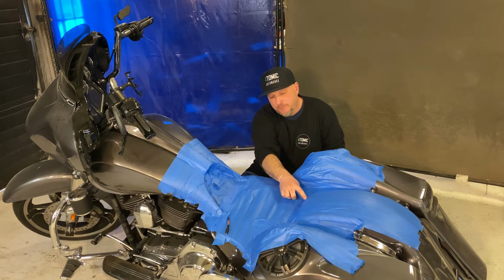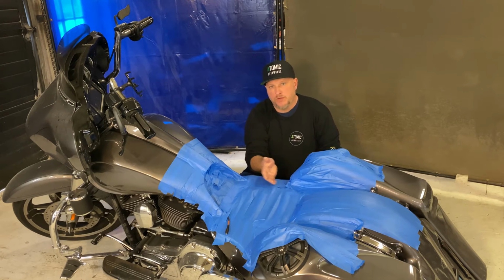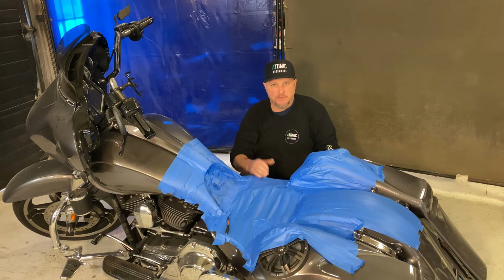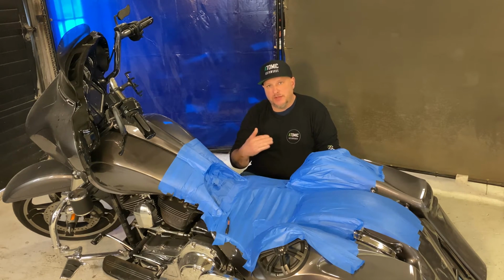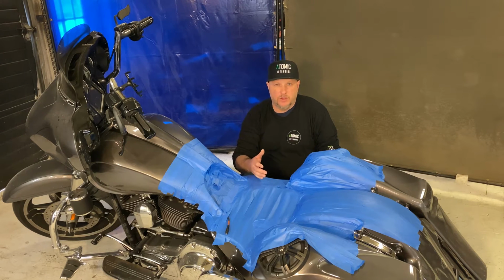And when it hits the front part of the rear fender, this area becomes too small with the material underneath it, and then your seat pan doesn't sit right. By doing this, you're actually making the gap that you really need for your material. Different materials or different thicknesses. Some people put different foams on it that wrap around. You always have to compensate for what you are doing. This just happens to be the way we do it.